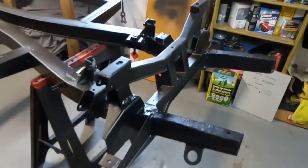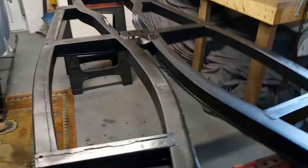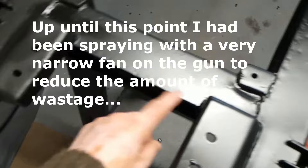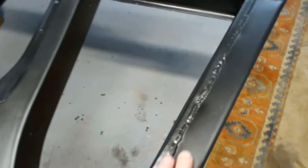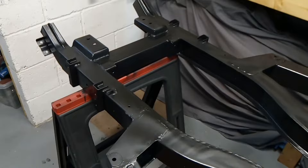I don't want to suck epoxy resin dust through the filter as it'll just spoil it. I'm quite pleased — it's looking good now. It's always best to keep flipping the chassis and spraying from different angles because you always miss something or it gets a bit thin in some areas. It's a little bit thin in places — it's a nice paint, I like the finish, but it looks almost matte. It's supposed to be a satin finish. Maybe I'll put a couple of quite wet coats on now just to see if I can get the sheen up a little bit.